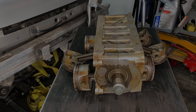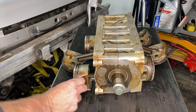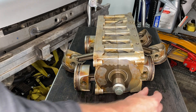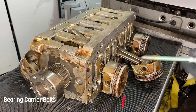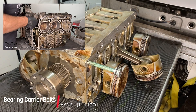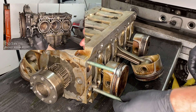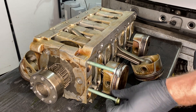Product familiarisation, everybody. Look at the front of this thing — the open-ended side is showing you that this is bank one and that's cylinder one. We're at the pulley side here, so therefore that guy there is cylinder four on bank two. Remember when we were taking out those bolts? They were holding the bearing carrier in place. On bank one we had two bolts, and the second one just goes in the bottom there — they're both T-50s. The top one has the seal; that's the same in both banks.